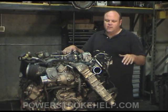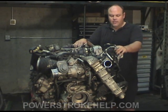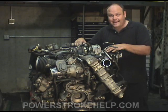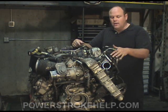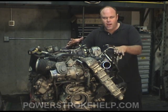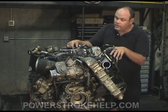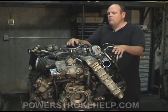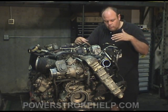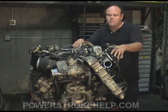The other side of the issue is why this engine gets such dismally poor fuel economy. I've heard it as low as 7 miles per gallon. I know a few people getting 12, but the 6.0 will get 15–16, and the 7.3 will get 15–18 if you tune it. I know folks with tuning on both those engines that get well over 20. I have an Excursion with a 7.3 that gets 23 miles a gallon — two-wheel drive. I have customers with two-wheel drive 6.0s at 19–20 all day long. The emissions control on the 6.4, by using the EGR system to meet emissions requirements, has greatly diminished the fuel economy. So that's a real problem.